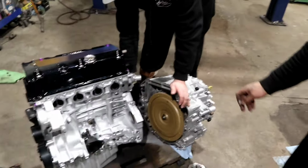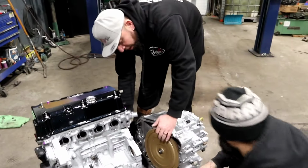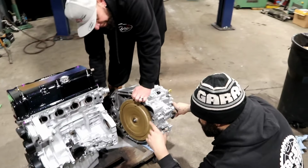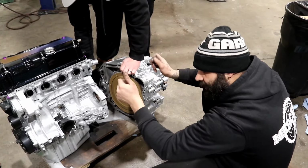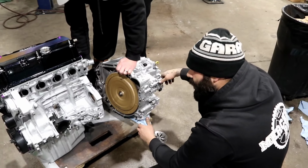All right, guys. So Mercer's already filled up a liter or a quart in the U.S. on the torque converter. He installed the torque converter. So there's three steps. When you put it in, make sure it goes in once, and you spin it. It goes in the second time, spin it, and then it goes in the final time. So there's three steps.